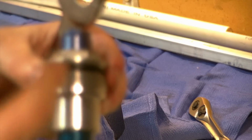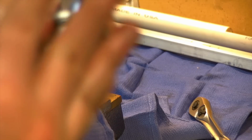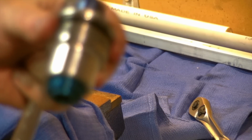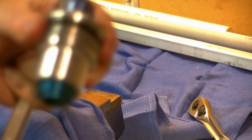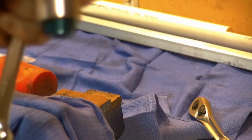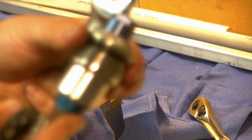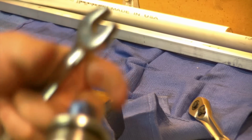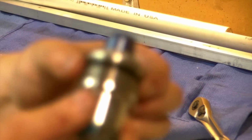Some bikes, the rod is D-shaped, the letter D, so it has a flat on it, and then as you turn that, that adjusts your rebound or your compression. Like my '82 Maxim XJ is that style, and you could get it misindexed, and then your settings would be wrong, so you could index them before you take it apart to make sure you go back to where you were. But on this bike, and most cartridge style bikes, it's irrelevant to that setup. This O-ring here we would want to inspect.